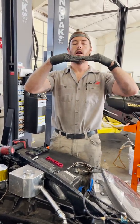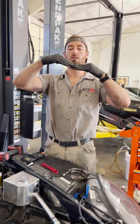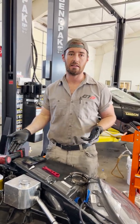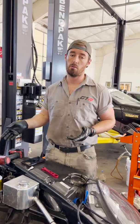If you think about it, your head is a plane, right? So if you start to take the bolts off weird, and some of them are tight, you can actually bend the head. You can get it out of spec just a little bit, and then you'll end up needing to plane it. We know this head's good, so in order to make sure that it stays good, we need to do the reverse torque sequence.